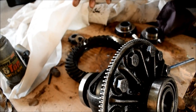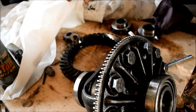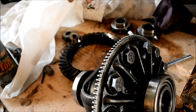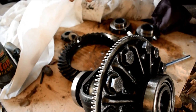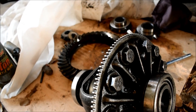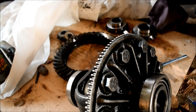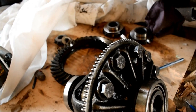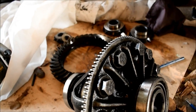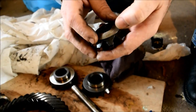Right, and it was out of balance as well. So not only that, the cheap Chinese steel that they use, or wherever it was ordered from, was probably bent. It was maybe welded crooked, and it wasn't balanced correctly. So we won't be doing business with that drive shaft shop anymore. But anyway, we bought a good aftermarket drive shaft, and we're good.